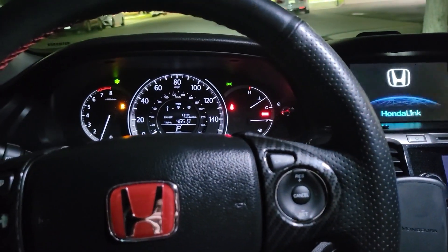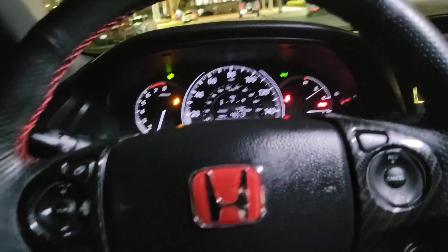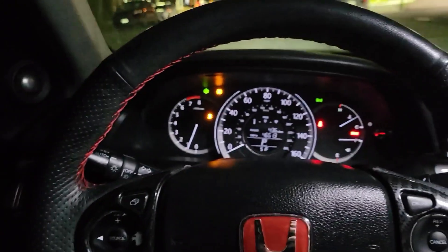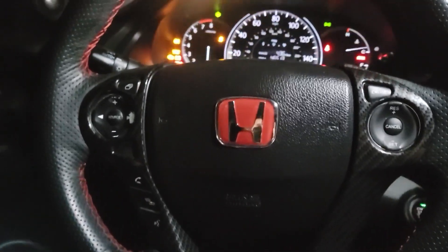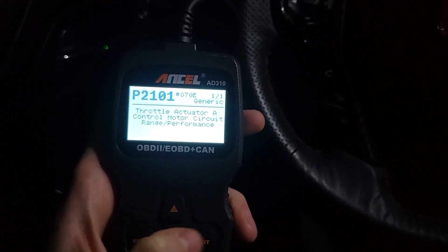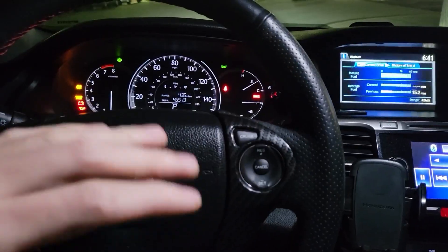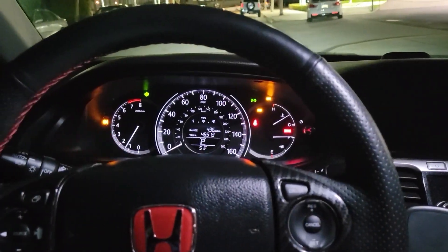We still have some flashing lights — traction control is not working, and we have TPMS flashing. Let me try to read codes while still plugged in. I'm still having that code come up. A lot of the lights did go away, but I'm going to do the same thing — turn the car off and have it with just the ignition on. Let's see if I have pending codes. I'll try again to erase codes. Erase done. We still see a flashing light there. This has happened twice now in about a month. Let's see if I start the car — car starts up, codes are gone now.